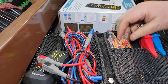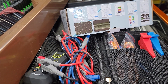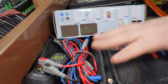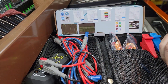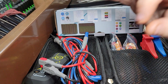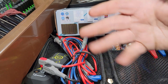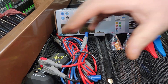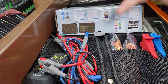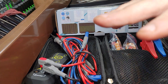I'm absolutely just floored by the thermocoupler that you can add on to this and the amount of testing that this thing can do. This is one of those tools where I could recommend this over my Snap-on — I love my Snap-on, don't get me wrong. But this Bluetooth function makes it super awesome. If I want to go to the back of the vehicle and test something, or I need to test a simple turn signal, I can leave this connected to the back of the vehicle, take my phone or tablet with me, and I can function the turn signal and see if I'm getting a voltage drop on it.